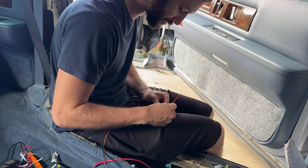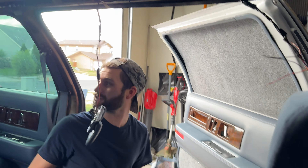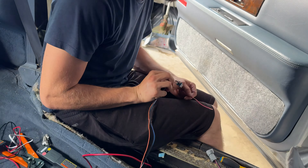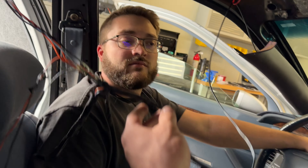We're testing — jumping some wires together because we have suspicions that this is pinned incorrectly. We're guessing the reason these two back here don't have real connectors is because this is a harness out of a four-door Fleetwood, probably related to the fire incident of 2004. We get 12 volts on this pink wire, which isn't going to anything because there's only three wires and the pink's going into an empty pin. We're gonna jumble the pins around, flip on the key, and hopefully these lights will work — if not, we've got a fire extinguisher over there.